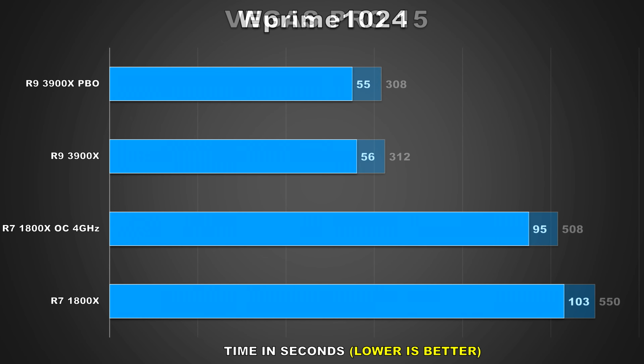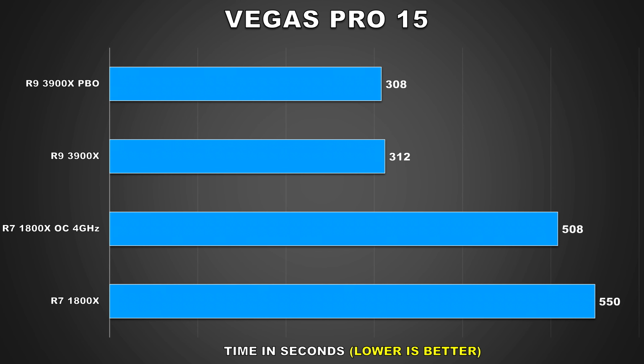Now it's time we shifted our focus to some real-world applications, and up first, we'll be taking a look at Vegas Pro 15, a very popular video editing software. For this benchmark, what I did was take a short game clip that was a minute and 30 seconds long, rendered it out using the Magix AVC format, and used the 4K 60fps preset with GPU acceleration off because I'm trying to see the difference here for the CPUs.